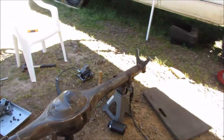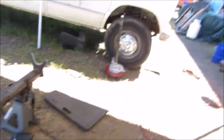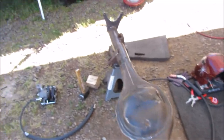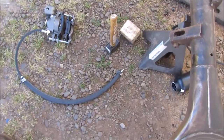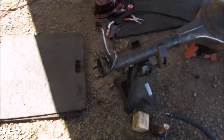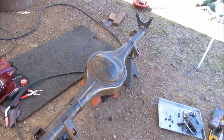So I'm finishing up welding these caliper brackets. I just pulled out my axle shaft so I can get around and do a full bead on them. I set up both axles and a third member in here to get everything square as it was supposed to be when finished. Then I rigged up a setup with just a chunk of hose so I can hook up my compressed air to it, so it would clamp down on the rotors — that way I could get my bracket where it needed to be and tack it on there. Now I'm going to finish those up and then get some metal for the truss setup.